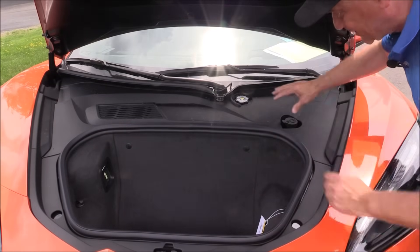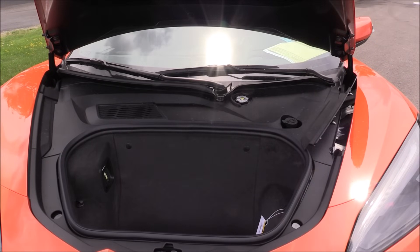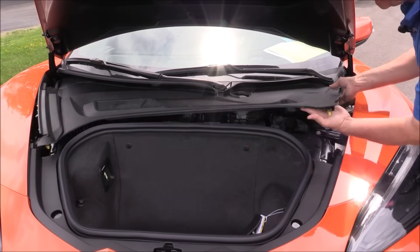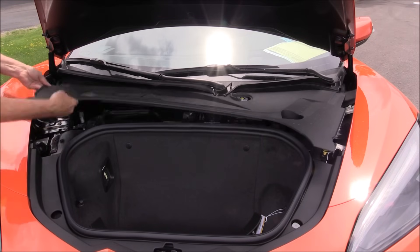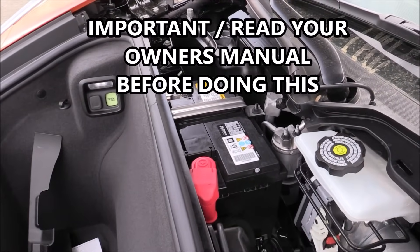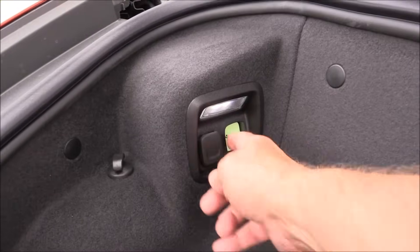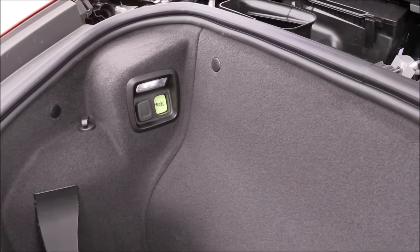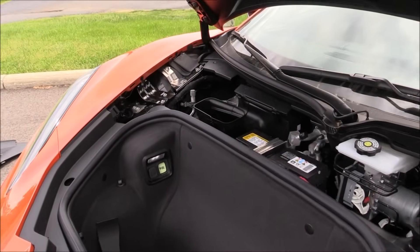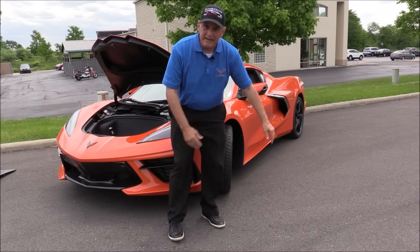As many of you know, the battery's back in here. To get to it, you have to take these plastic pieces off — just reach underneath and pull them out, both sides. This way you can gain access to the battery area. There's your battery. If you're going to jump or charge the battery, many of you have the battery tender from Chevrolet — it'll be in a box like this. Plug it in here. It's going to be plugged in for quite some time, maybe overnight. See if you get some power, and again, get to the dealership to do a direct download, which should alleviate any problems you've been having.